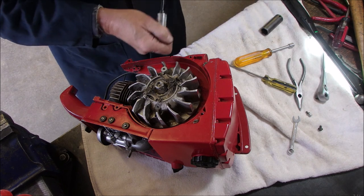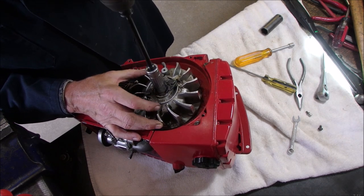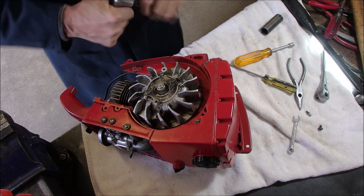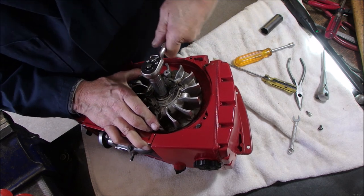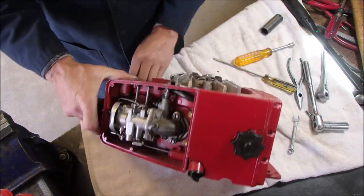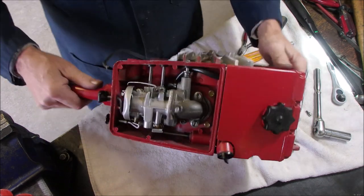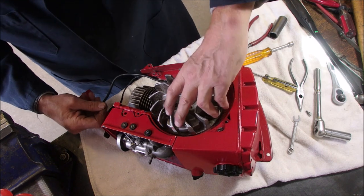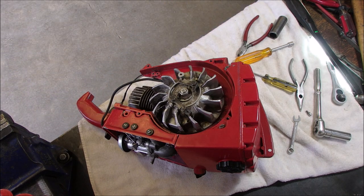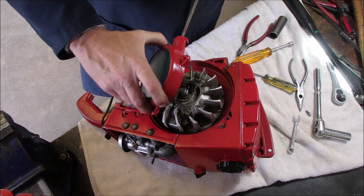I'm gonna cheat a little bit, you guys. And that's about right. I should be able to feel a spark on there because the ignition wire is not grounded. You guys on to me? Yes, you are. There we go. We got spark. I forgot about that. Now, when we get the rewind out, you will see that the rewind actually pulls this thing in a counterclockwise direction.